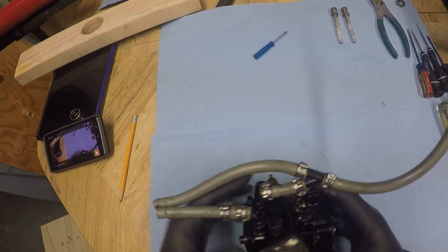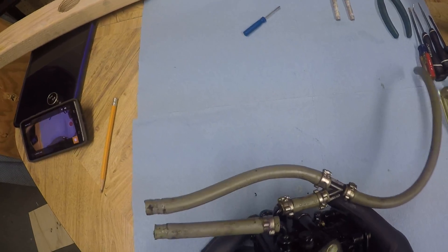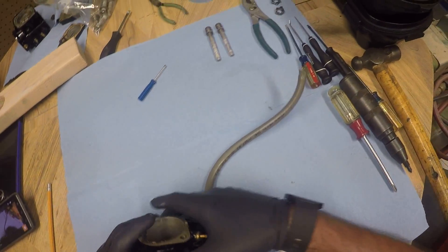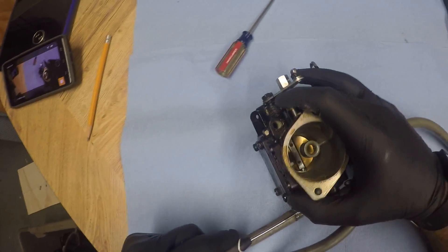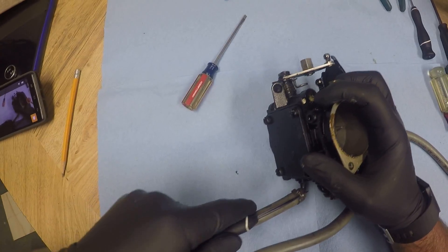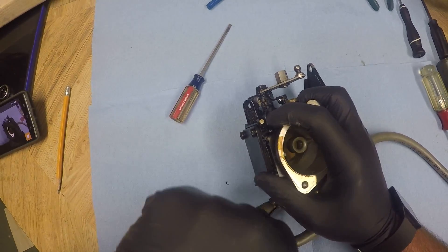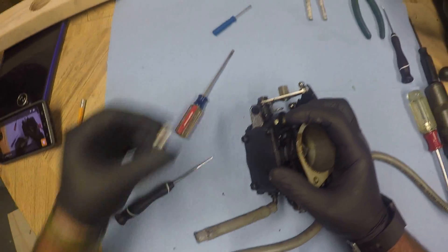As you see there, just removing the bolts that retain it down into the engine, removing a couple of the clips from the fuel lines. We're going to remove these clip-style clamps and remove these fuel lines. That can be achieved by just inserting a pick in between the clip portion and wiggling it out. You'll hear it click loose and then the clip is released. They are reusable — you can go to a crimp-style clamp. These are the factory clamps that were used.